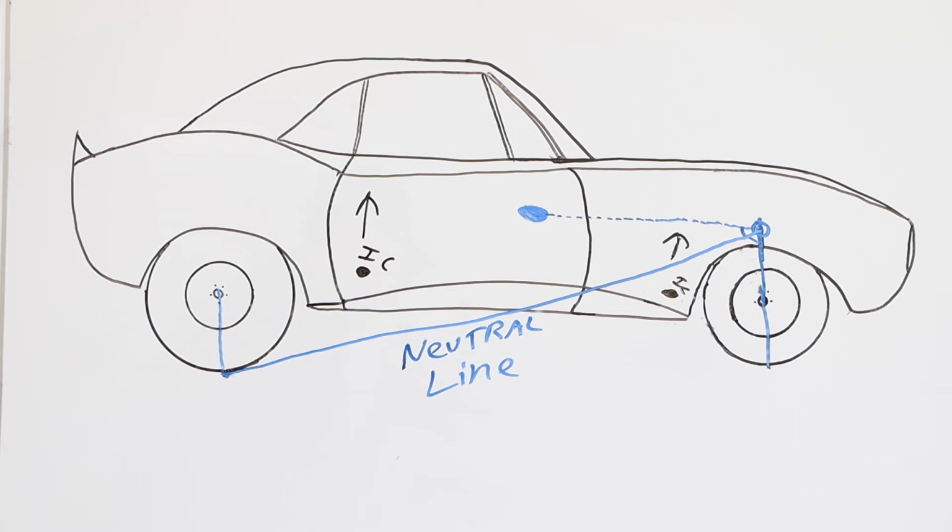So I quote, since the car rotates around the center of gravity and the instant center is a point of lift, you can see that as the instant center gets further back in the car, it lifts the rear of the car. The further forward the center of gravity, the more likely that the instant center will lift the front. This is a basic element of an early understanding of the control over pitch rotation. A more rearward location is more violent, but is actually lifting less load as it moves away from the center of gravity and the car pitches. Moving the instant center closer to the center of gravity makes it less violent, but there's more load that will be placed on the tire.